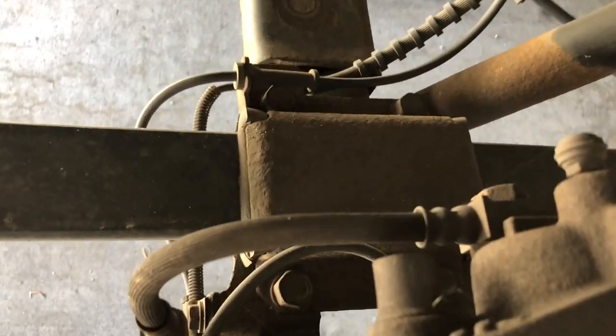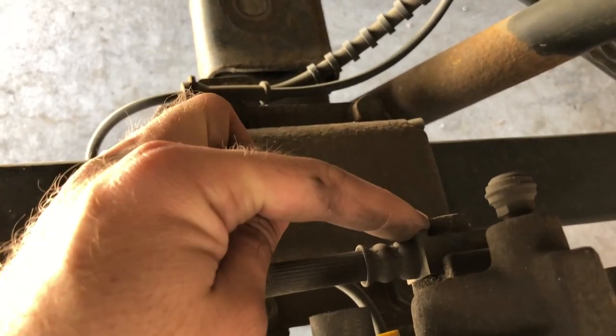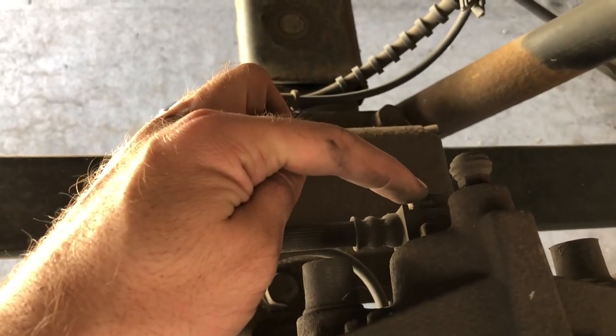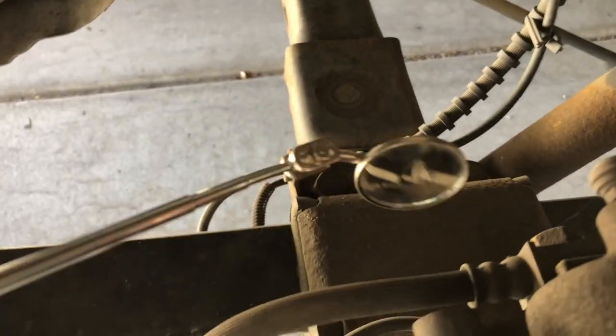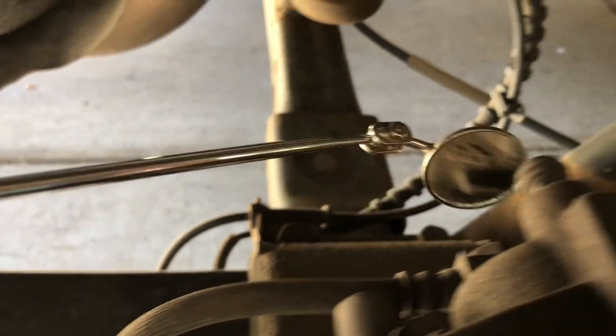I started taking off what I thought was the right piece — but that's the brake fluid cap, don't touch it! Leave that alone on the 2006 Dodge Grand Caravan. This is where my little dentistry mirror came in handy. I looked in there and right inside there's a bolt on both sides. That's step two: we got the tire off, now we got to take off those bolts.